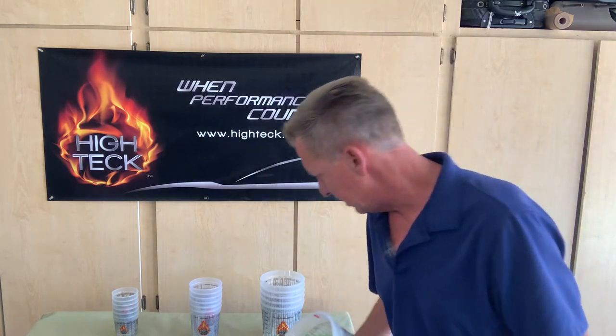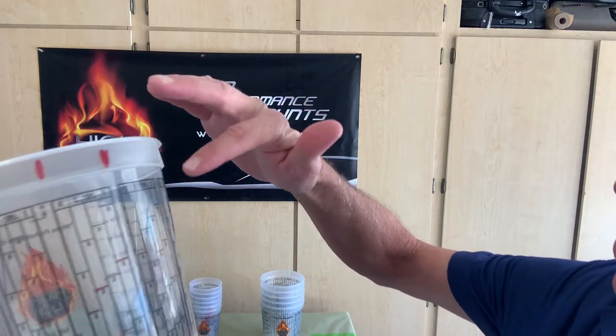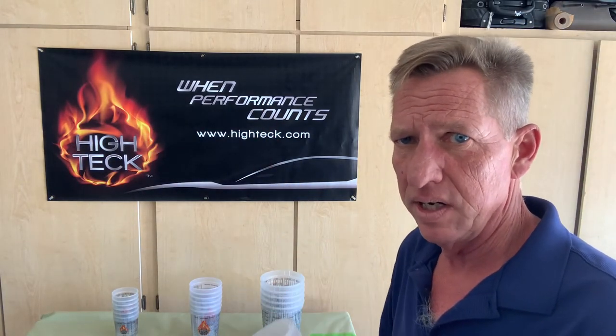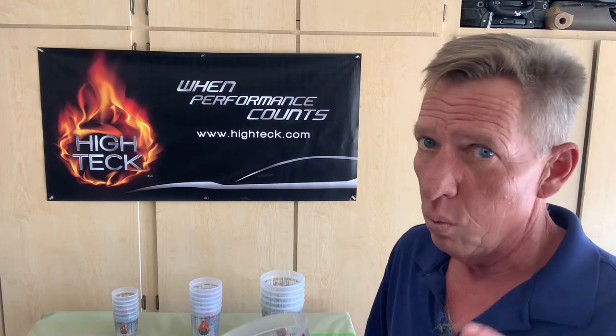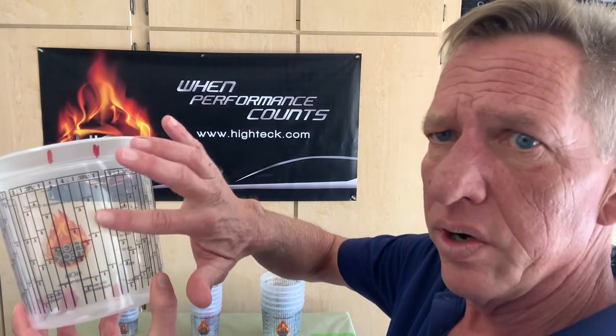So let's take a deeper look at the mixing cup. On this cup, you'll notice a whole bunch of different columns with different mixing ratios. For example, if we're going to spray the acrylic urethane single stage paint, the mixing ratio is four to one to one — four parts paint, one part activator, one part reducer. So I'm going to find the four to one to one column. Now in there is also a 10% ratio — at four to one to one, we're going to ignore that.